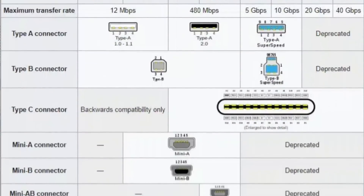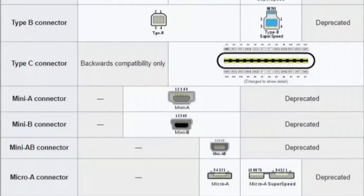That is particularly true of internet connections. And finally, not all USB ports are created equally. If you are going to use a USB 2 port, it significantly reduces your performance. USB 3 has been broken down into USB 3.1, 3.2, USB 3.2 Gen 1, USB 3.2 Gen 2, and then X2, all with different bandwidths. And then of course there's USB Type-A and USB Type-C — different physical connections which may well need an adapter. But with those disclaimers out of the way, let's talk about some great USB NIC upgrades.